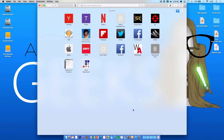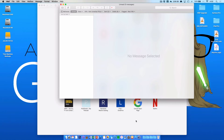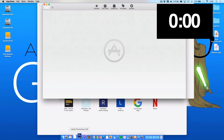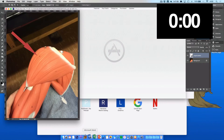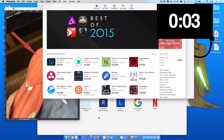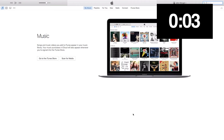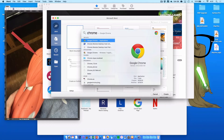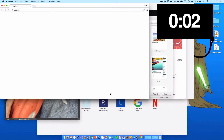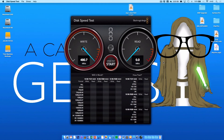And now let's see how the Samsung Evo fares in the opening of applications. We will then compare these times to the time it took the traditional hard drive to open the same application. And I think it's already apparent that the Samsung Evo SSD is just blowing the doors off my traditional hard drive. I'm very curious to see how these times stack up. Now, as we did for the traditional hard drive, let's do a read-write test so we can have a quantitative comparison.